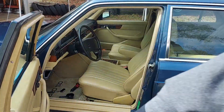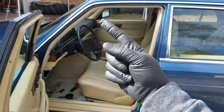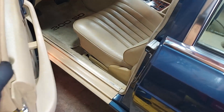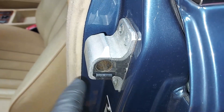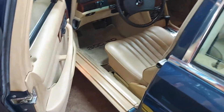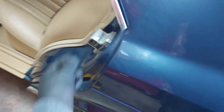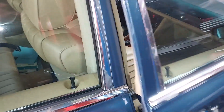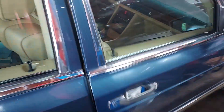Let's pull it back into the garage and change some fluids and start on the AC system. While off camera, I also replaced the rubber tab on the driver's door — that little tab was deteriorated. I removed the striker and changed it. That tab hits the latch mechanism a millisecond before the door shuts, allowing smooth closure. Checking the back doors — those are still good, still in place. It was really just that driver's door.